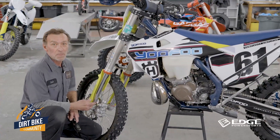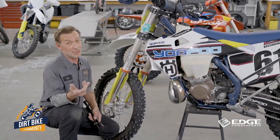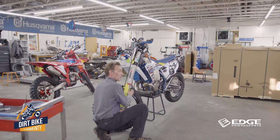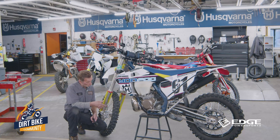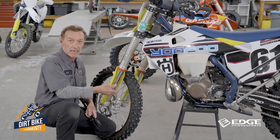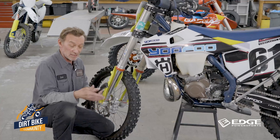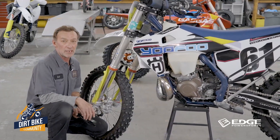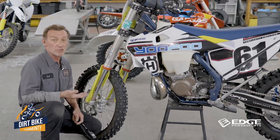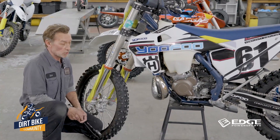If you don't have a bike with this type of setup, you can use a zip tie — that's actually an old road race trick. Just put a zip tie on snug enough that it'll still slide up and down. Before you start your moto, pull it all the way up to your dust seal, and when you're really getting after it you can see how much travel you're actually getting. That tells you how much air pressure to add, and you can also fine-tune it with a little compression.